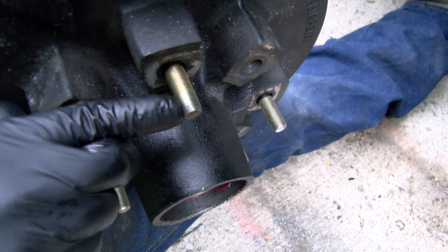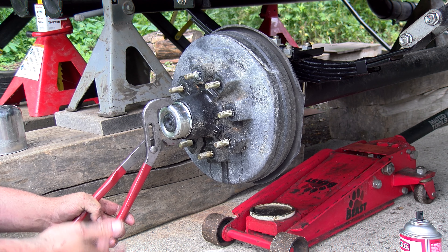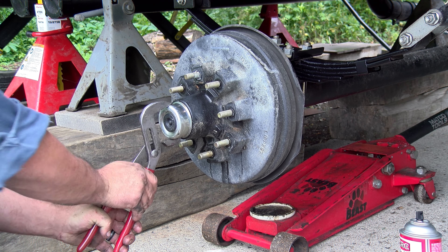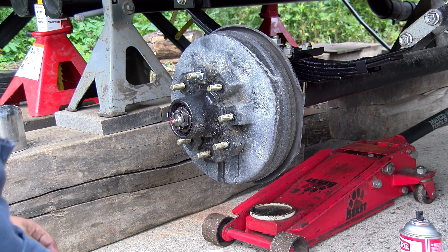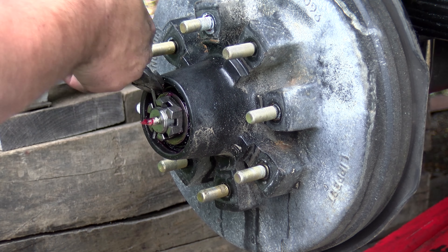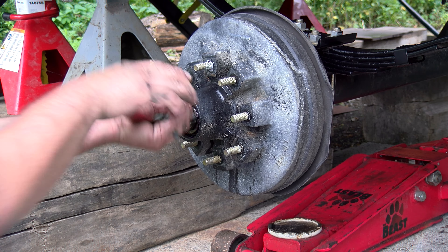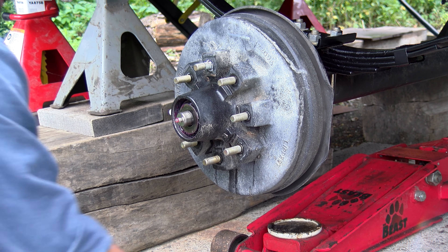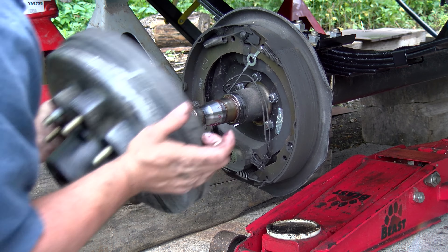If you're really looking at this, what we're seeing here is multiple stripped-out studs. To break off the drum, you've got to pop the dust cover — nice and easy with a pair of channel locks. You can also do it with a screwdriver and a hammer. Just make sure that you don't dent the ring. Just get it to pop, just like that — no pressure, no dents, no nothing. Good to go. Take the cotter key out using a pair of side cutters — other people call them dykes, diagonal cutters, whatever you want to call them. Pull your cotter key, set it off to the side. Pull the lock nut, set that off to the side. Pop your drum so that you can get to the outer bearing and take that off. And then you can pull your drum assembly.